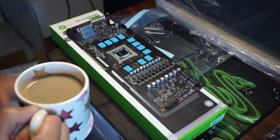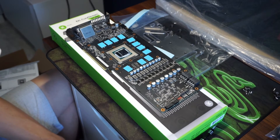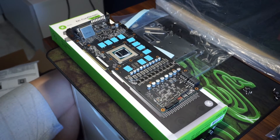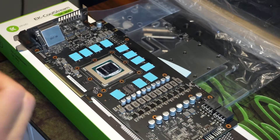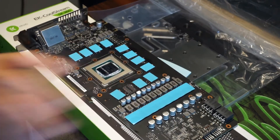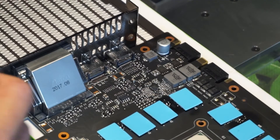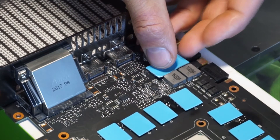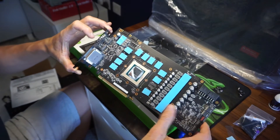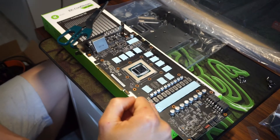I'm definitely very uncomfortable dealing with this at the moment — it's the first time I've ever installed a water block, so I'm doing things slowly and making sure everything is in the right place. Make sure you remove the plastic film obviously. There are two more chips just up the top left that we need to cover. That should be all the thermal pads applied — make sure you double check to confirm you're not missing any. I've taken all the plastics off the thermal pads now; make sure you've done all of them so you don't accidentally miss one.